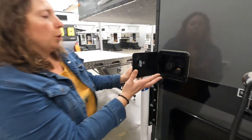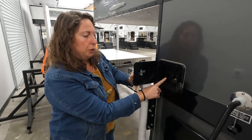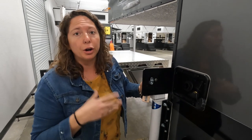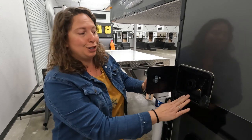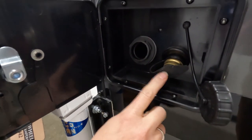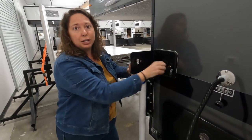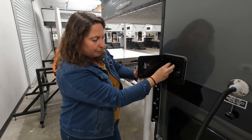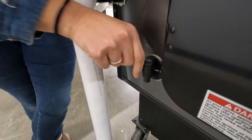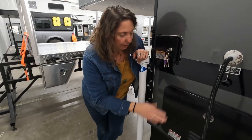This is your water fill door — this is where you fill your 20-gallon fresh water tank. I always use a filter and a water fill hose, and you can fill it from home, campgrounds, or RV parks. Here is your city water connection. You will get an extra pressure attachment — if you're connected directly to city water, use that pressure attachment to ensure the right pressure is going into your camper. And this here is your water drain, which is how you drain your water tanks and is the lowest point in the camper.